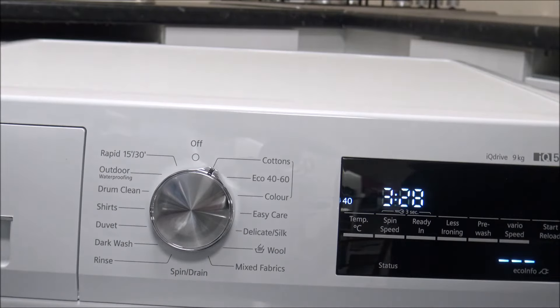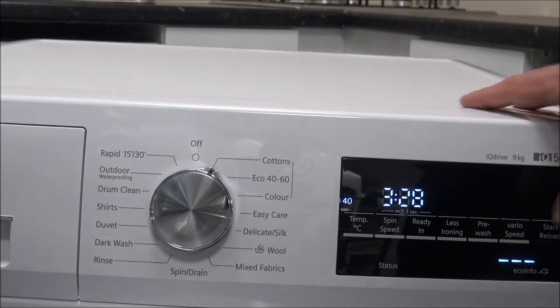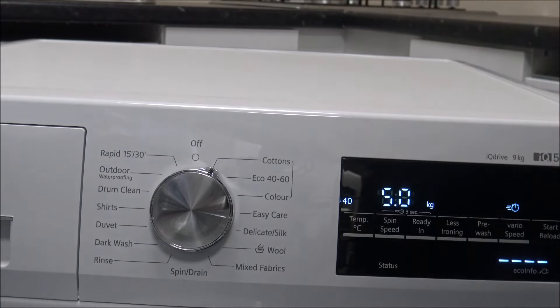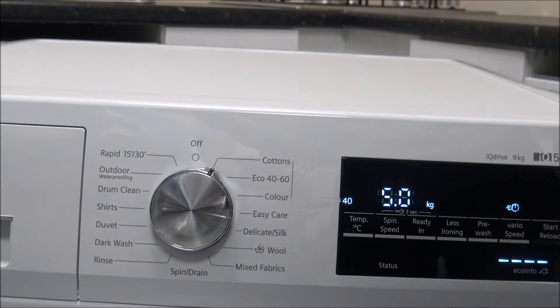One hint or tip on Siemens or Bosch washing machines is to look out for the option called VarioSpeed — on Bosch washers it's called Speed Perfect. This will reduce the wash time. On the Cotton program, as you can see at the moment, it takes 3 hours 28. If you press that, although it does reduce the load size, it reduces the time by over half — down to an hour and a half. The machines are intelligent enough to take in the amount of water required according to the wash load and can change the wash time as well. If you've only put 3 or 4 items in, it wouldn't wash for the full hour and a half — it would reduce the wash time. Equally, if you put too much washing in, it could go over that time, and if you put too much detergent in it will take longer because it needs extra water for the rinses.